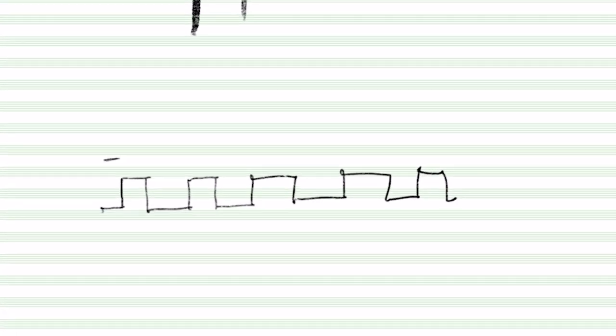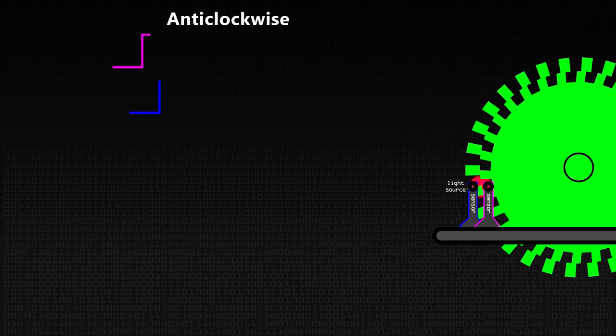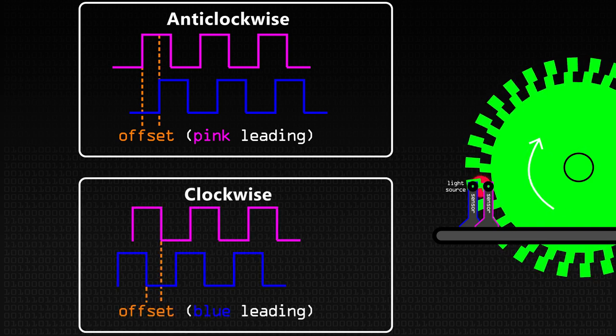Because we've got that lightning shape, with that second sensor, the signal is delayed slightly. So we've got this first signal here, but the second sensor would be delayed by a certain amount. So actually the pulses would change, delayed compared to the other one, as hopefully you can see in the diagram I'm drawing very badly here. So you'd have two sets of pulses, one delayed from the other. It's what we call quadrature encoding. We can actually derive from that which direction the signal is moving in.